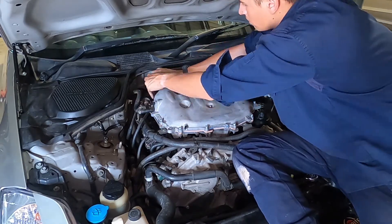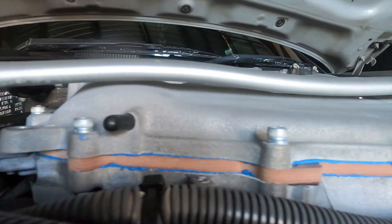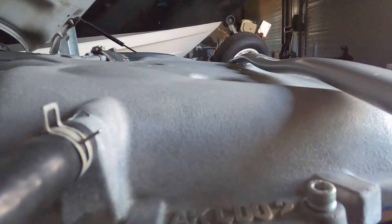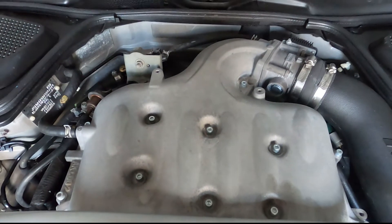After this we're just going to chuck everything back on — all the air intake and whatnot — and then it's finished. This is the finished product: the 8mm 5/16th plenum spacer installed. You can see the clearance between the top of the plenum and the strut bar. This is the smaller spacer size — there is a 16mm or 5/8th size, but I really don't think they would fit on a 350Z with the strut bar still installed; I think those are more for the V35 and G35s. I definitely think this is a worthwhile mod for a VQ35 though — it was pretty cheap and really quick to do, so definitely look into it. Thanks for watching; if you've got any questions, drop them in the comments below.